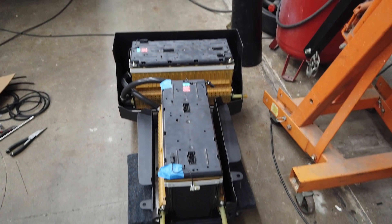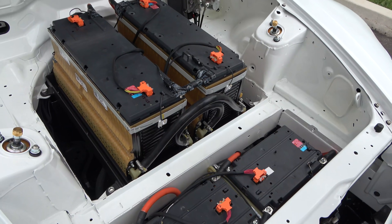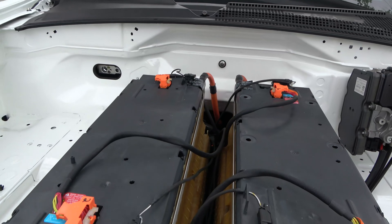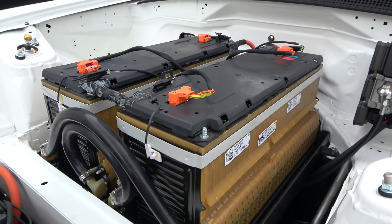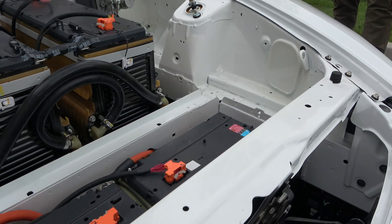There are two Chevy Volt battery packs in the engine bay, with 96 cells each — all those cells need to be monitored by the battery management system, which is why there's so much wiring visible. What I'm going to do is hook up the AC lines — the compressor is mounted underneath the headlights — and then build what I call a 'sarcophagus' around the battery packs. It'll have cut windows on the sides so you can see the cells, and a carbon sheet on top, so when you pop the hood it looks like clean metalwork with a carbon panel.